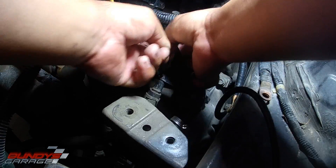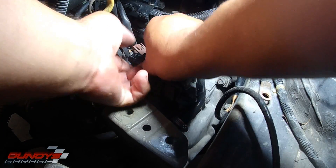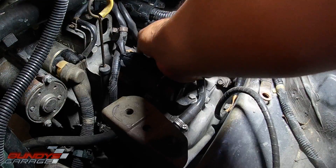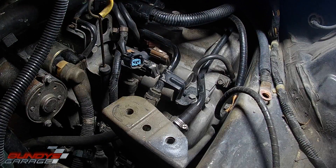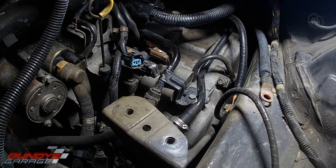Pull out. There's one, there's two. Another issue that could come up — I've seen it where your D4 is blinking. I've solved that problem with an additional ground strap wire. Right here you can see there's a ground strap wire and it goes right there. I just added an additional ground wire because Hondas and Acuras are known for having bad grounds.